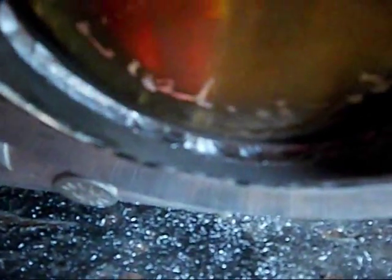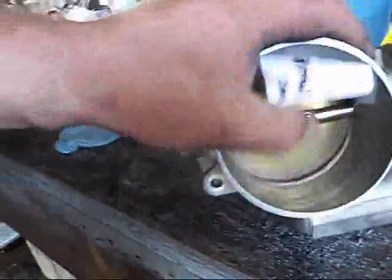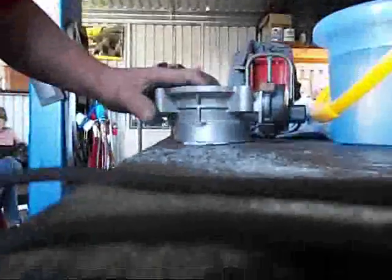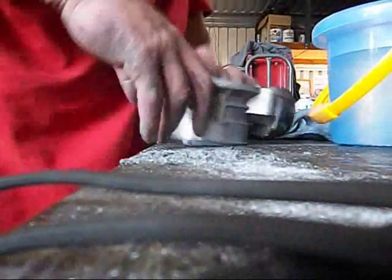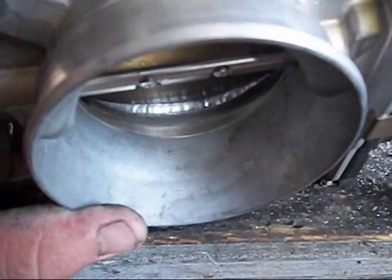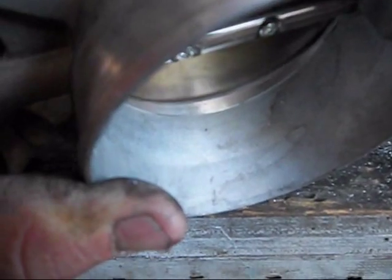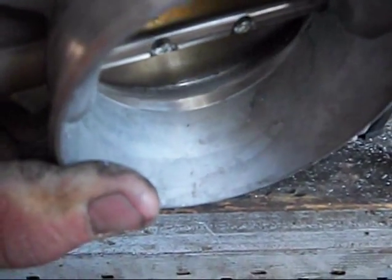Let's see if this thing will focus a little better. You can see there's a little bit of clearance here between the throttle plate and the groove. Now looking at it from the front side, you see there is your black line. I'm just going to pop this loose — it's going to be real simple. Push it down, push it around, and pull out your business card, which is now wasted. Now when you look down at the throttle body — and this is the test — you can see the groove. You can very clearly see the black mark, which is the natural idle position. We close this up and that's where the engine will be idling, right there. It's going to relax that far. That's how much room you have before the groove actually gets in and kicks in to full force, right about there.